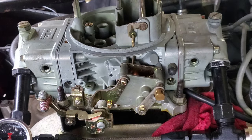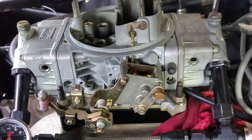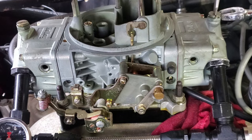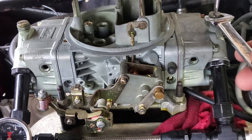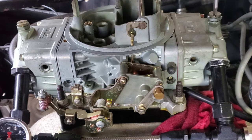As you can see, there's a stream of fuel coming out and we don't want that. So I'm going to put my flathead screwdriver in, turn the brass retaining screw out just a little bit, and then crank down on the 5/8 nut clockwise to lower the fuel level. I just did about a quarter turn.